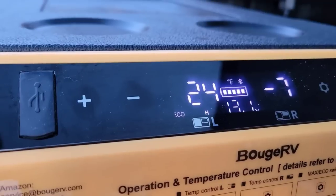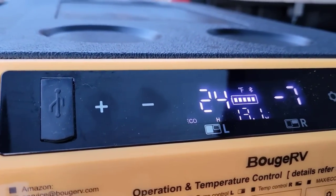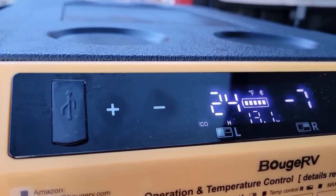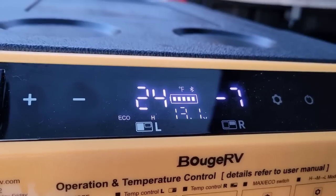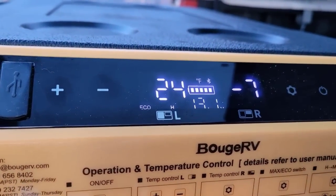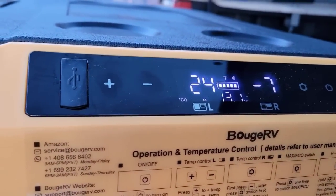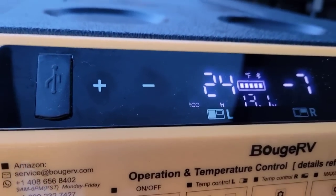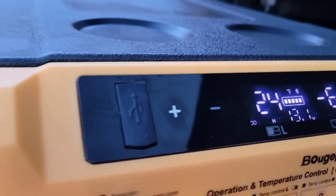In my opinion, that's not really a good thing — if it says you can set it at 38 degrees for things you don't want to freeze but want to maintain fresh, it should maintain at 38, not 24 or 28. The negative seven where the lowest setting is negative four is okay — I don't think negative seven would damage frozen items any. But something you didn't want to freeze could be damaged if you set this at 37 or 38 degrees and it goes down below freezing.